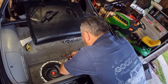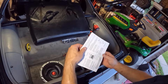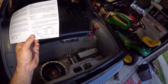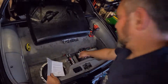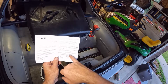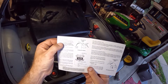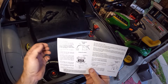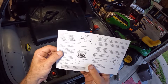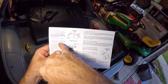Old capacitor removed. This is the feed to the amplifier, this is the feed from the battery, and this is ground right to the chassis. The terminals are reversed on this new one versus the old one, so I had to switch my cables — no big deal. I've got it positioned where I want it; it's going to look fine in here. They do recommend a distribution block per the instructions, but for now this will be electrically the same.